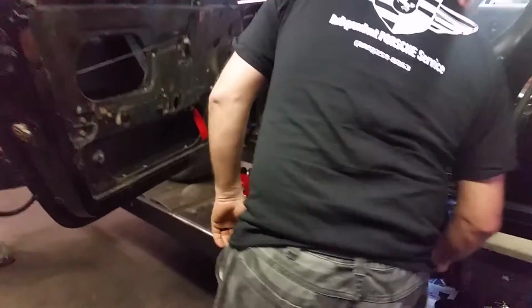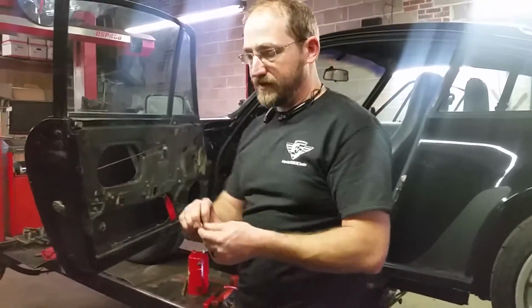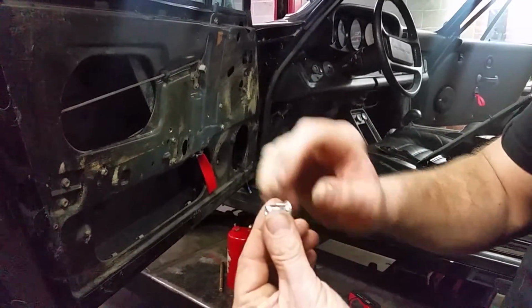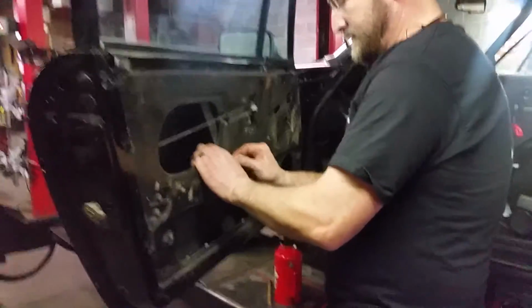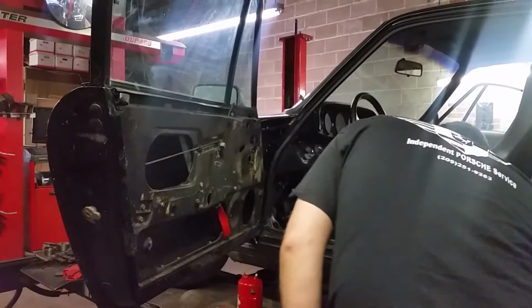All right. Next step is to put these, I call them jack nuts. They look similar to something you'd put in sheetrock. And what this does is as you put this in the hole and as you tighten the bolt, these collapse and provide a lot of back support. Four little fingers of back support. Okay, pop that in. That was a 3/8 drill bit, by the way.